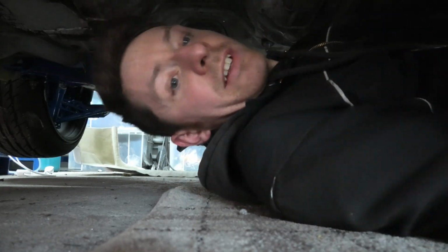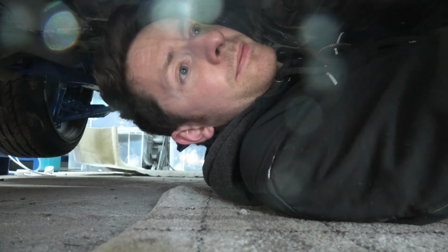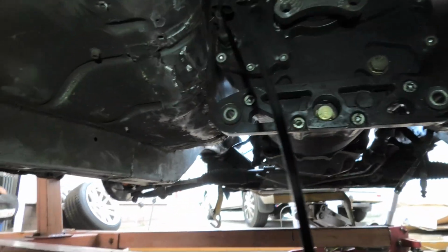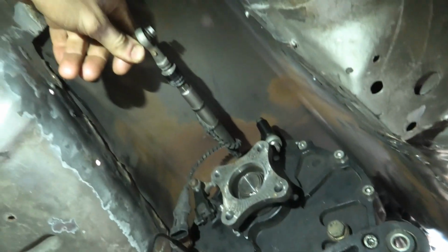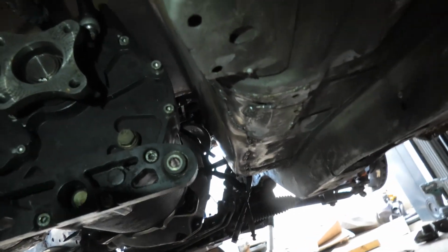Right, so we'll get underneath the car, have a look, see what I'm doing down here. Got an illumination here, there we go, magnetic one goes up there, right. Now, because I've been a genius and cut off the existing mounts, you can't actually see where the old mount used to be. So how I'm lining this up is I've got my arm from a shifter and it needs to be about 40mm down, which I think is going to sit about there. I think that's going to work out. I'm maybe going to have to shorten it a bit or lengthen it depending where I'm putting the new shifter. You can see that I've got clearance that side and clearance this side, but it's not lined up yet, so don't get overexcited with yourself. It's not lined up yet.